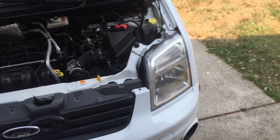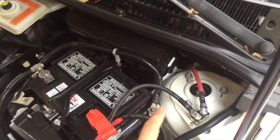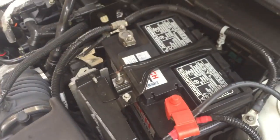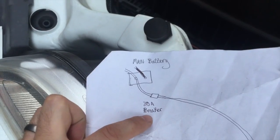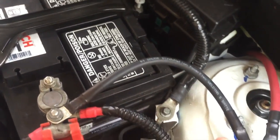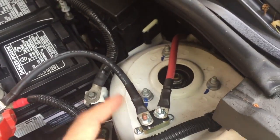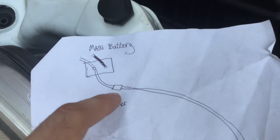I've got the rough schematic here of what I did for wiring up my van and we're going to go through it step by step. Keep in mind I ran out of red wire so some of the positive lines are going to be black. Here we go: the main battery under the hood - positive line leaving the main battery going into a 30 amp breaker, which I have bolted to a little piece of metal. Then a positive line leaving the breaker going - it's a long line - all the way to the back of the van going into a smart isolator.